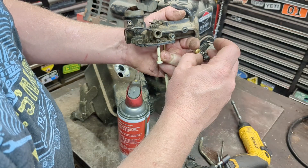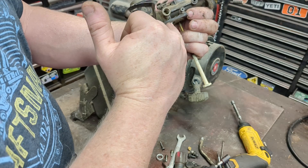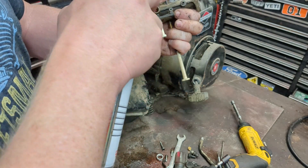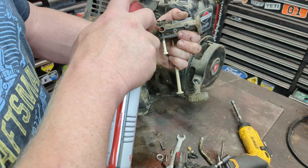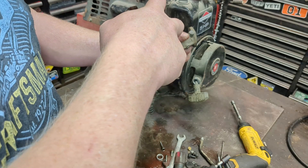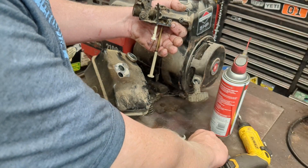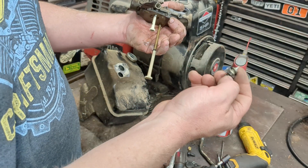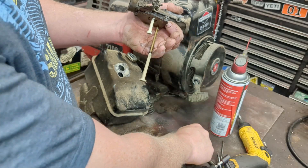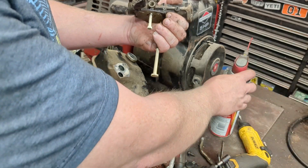The needle's distance from the hole regulates how much fuel goes through. There are just a couple of passages - follow the tube that comes up and there's a passage that goes down to it, right in the side of the thread. Just spray through the different passages - you'll see them all, super basic. Let some carburetor cleaner sit in the bottom for a minute. That carburetor is clean - there's nothing to replace. I see people buying jets and stuff but they just don't wear out. The $18 rebuild kit is unnecessary - everything's just dirty, just clean it.